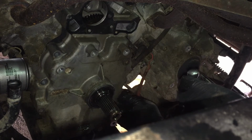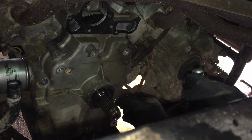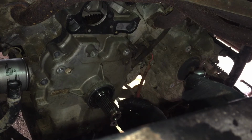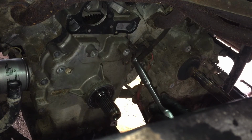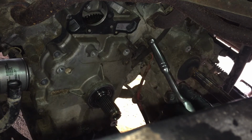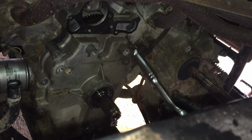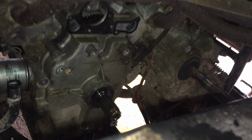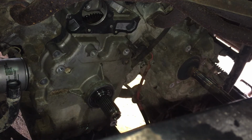Alright, so I'm wondering, the side cover gasket on this thing looks like maybe it's been reused or something. I'm wondering if somebody has been in here before. And that was the same. Some of these had plastic cam gears and they were bad about the teeth coming off the cam gear. I don't know if this one does or not. I kind of think it does. I guess we'll know more when we get inside. I guess that's the cam gear right there, but I can't really tell if it's plastic or not.